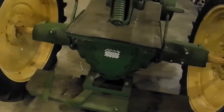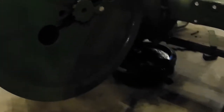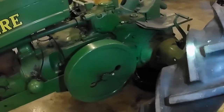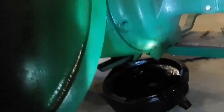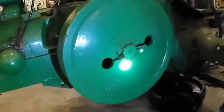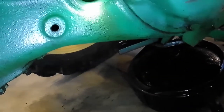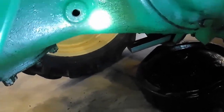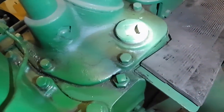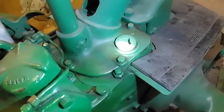It's still dripping just a little bit, but I've removed the little check plug on the side of the case. To check the level of oil, there's a little square-headed plug on the side. In relation to the hand starter or flywheel, right behind it is that little square-headed plug. I've got the plug out and I'm going to leave it out. I'm going to pull this fill plug — it takes a three-quarter-inch drive, so keep that in mind. A lot of guys don't have a three-quarter-inch drive.